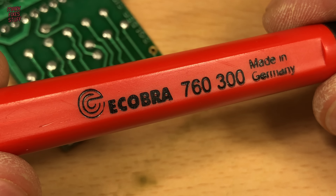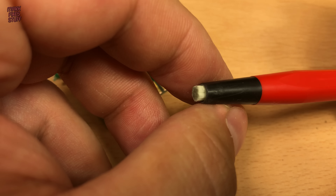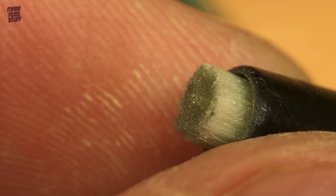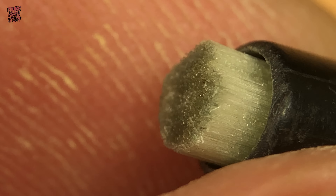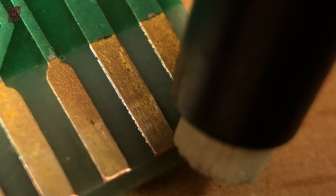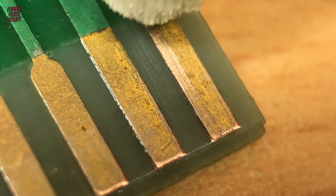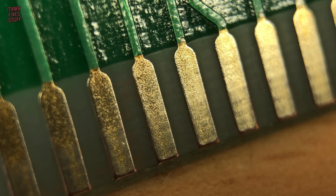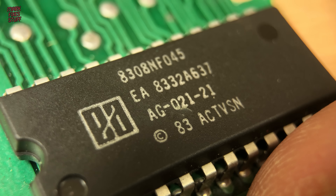This is a fiberglass pencil. Its tip is composed of hundreds of needle-like fiberglass shards. When you use a fiberglass pencil, be careful because the dust created is an irritant and the fragments can get lodged in your skin like splinters. Using the tip of the pencil, we wear down any oxidisation or dirt on the remaining contacts. The contacts are looking much better now and should put paid to any need to wiggle the cart in the console.